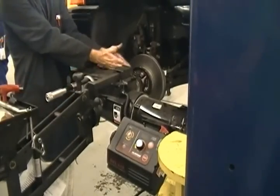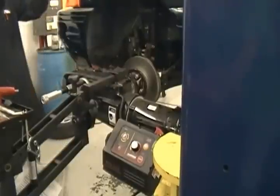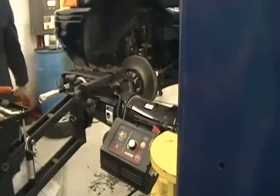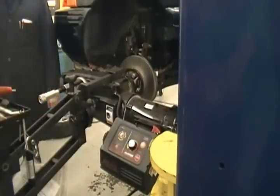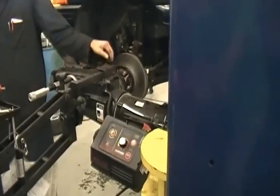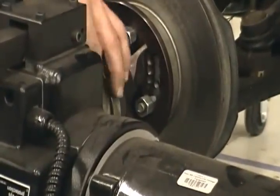Well, you want to make sure where your lathe comes up to the adapter, make sure that your hole and your bolt head lined up so everything comes up flush before you connect it. Okay? The other thing I failed to mention, but it's not too late, you want to be sure that this piece right here will spin. It's got to be loose like that.